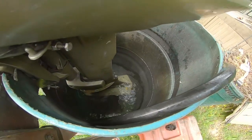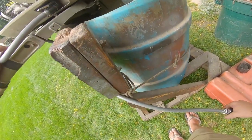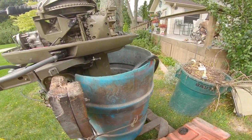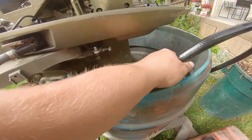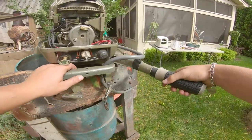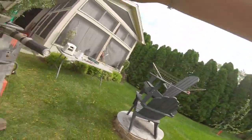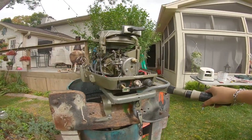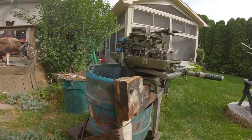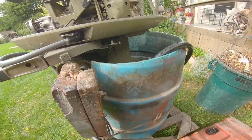The water is just about thoroughly over where I think the intake is — I'll let it fill up a little more then get her started. Gotta make sure the primer bulb is facing pretty much vertical, not horizontal. I think we're about good — let me turn off the water. Throttle's all the way back — let's see. Water pump works! Okay, the water pump works!